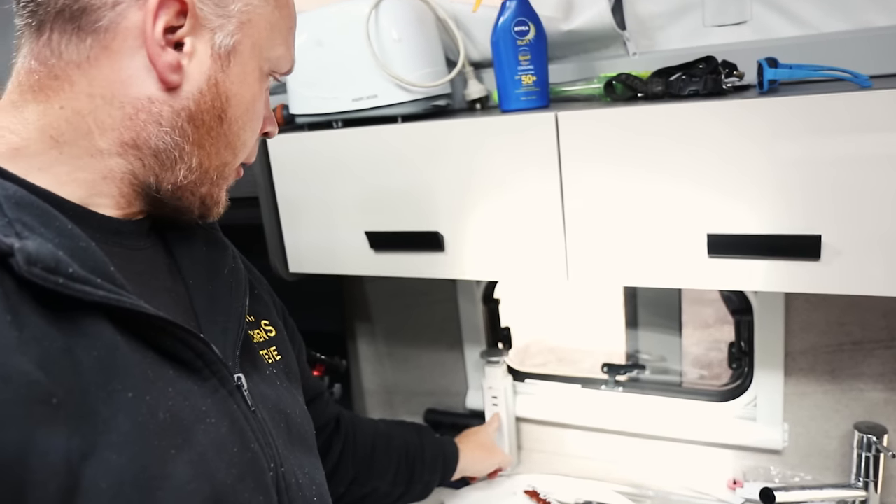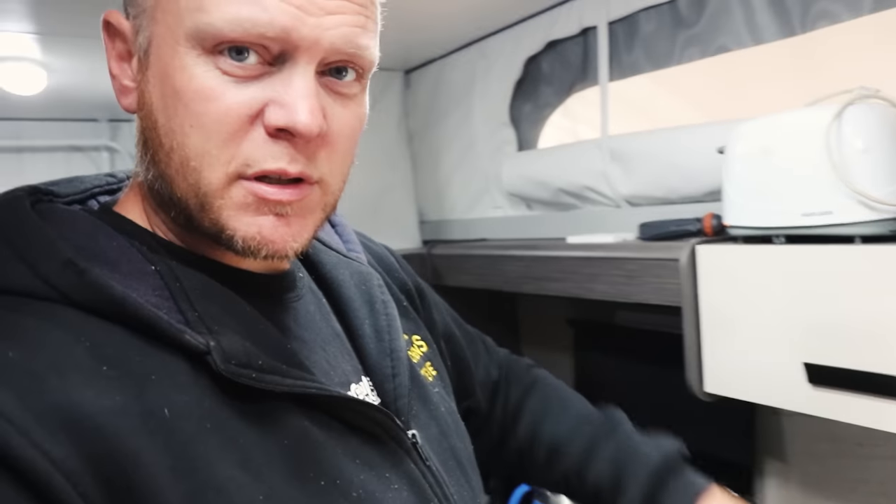Inside, you actually probably wouldn't pick the fact that it's fairly well set up for electrical. I've added a little pop-up with two power points and USB sockets - that's just so I've got some actual power on the kitchen side, because in the Jaycos there's no power on the kitchen side, which is just a bit stupid. There is a power point down below the bench, so that's what that's plugged into. There's not a lot in this van from factory. Obviously there's the outside power points, it's gas cooking inside, and I've changed it over to a 12-volt and 240 fridge only - so it doesn't run on gas; I think they're inefficient.